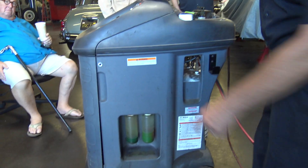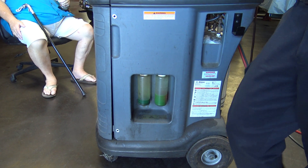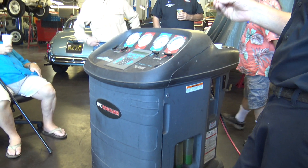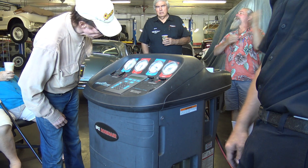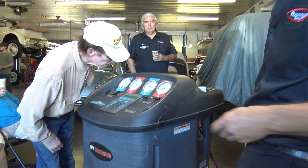This machine has oil bottles on the side, labeled R12 and 134, and you can see it's got that green color. That green is a fluorescent dye that you can inject. It goes in there, and then you use a black light — or ultraviolet light — and with special yellow-colored glasses you can see any leaks. That's one way.